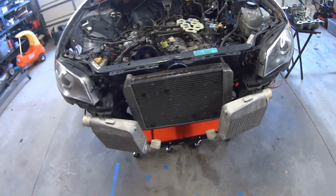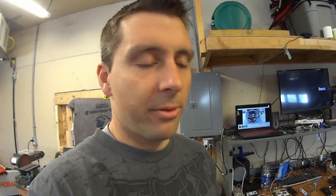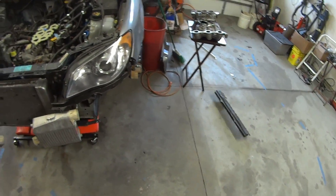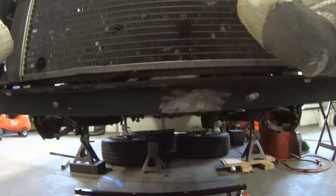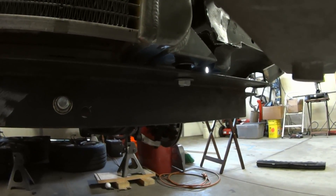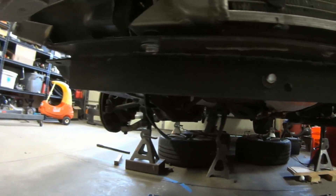What I have been doing is mounting my intercoolers and also lowering the radiator. I was really satisfied with the way I had the radiator mounted before — me and my buddy Jordan made it awesome — but that worked great for NA and the positioning was a little off for my turbo aspirations. So I cut that section out and fabricated a bracket. Nothing fancy — it bolts on right there with some MIG welding. The radiator bolts to it the same way, with a piece of rubber hose between the bolt and the aluminum radiator and the bracket. Works out pretty well.